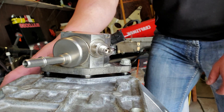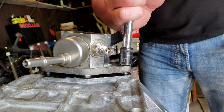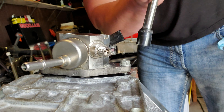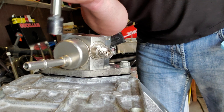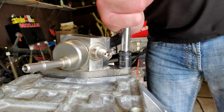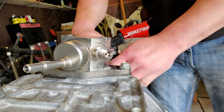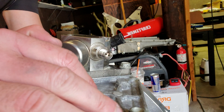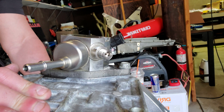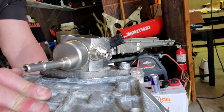With it all on there, we've done this several times already. I've actually cranked the bolts down. When you install a high pressure fuel pump, you want to make sure that you crank the bolts down evenly so you don't bind the lifter assembly. When we get those all the way down tight, we can also turn the crank over. Go ahead and do another revolution. When you're turning the crank with a short block out, you can feel if there's any binding — it all turns over very smoothly.